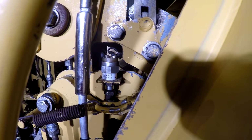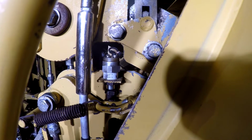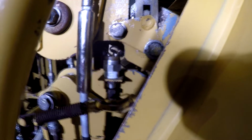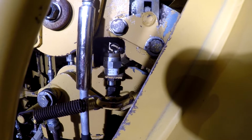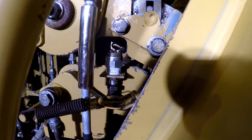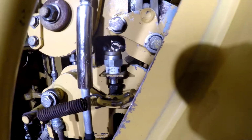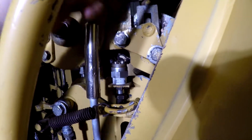Like I say, with no load on it, it shows to be working, but it's not passing the ground signal in order to reliably make that solenoid work. As you see, sometimes it releases, sometimes it does not. And if I take a screwdriver on these back terminals back here, you can't hardly get to it, but if I touch those terminals together, the solenoid engages.